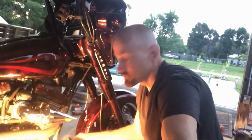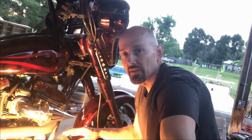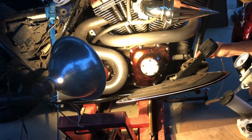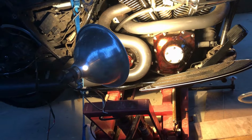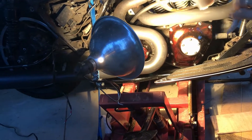What we're going to do today is drain the brake fluid and put new fluid in the rear of this motorcycle. First thing you want to do is take off your reservoir cap. You can see inside it's all kind of dirty. Now I'm using a MightyVac system to extract the brake fluid from the master cylinder, and as you can see the brake fluid coming out is dirty and filthy.